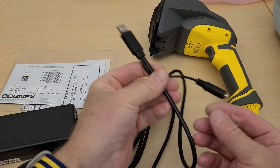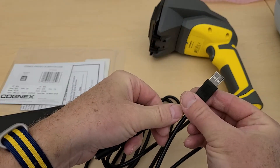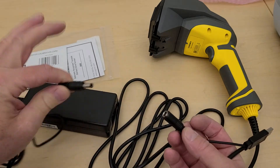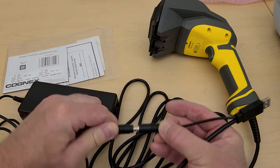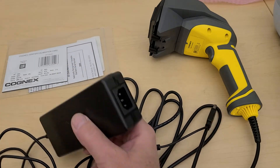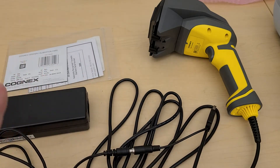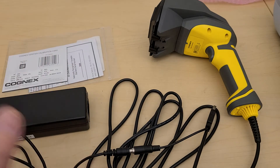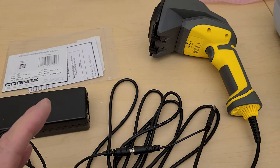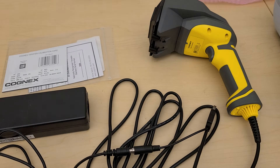On the other end you'll have a Y cable: you have the USB end that goes to your PC and a power plug as well, which comes from this power brick. You'll connect that along with a power cable that goes to the wall. It takes almost a full minute to power the unit up, and you should not plug it into the PC until you've installed the software — that's extremely important because the driver has to be installed before Windows can understand what this device is.